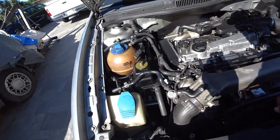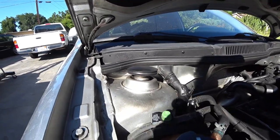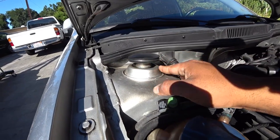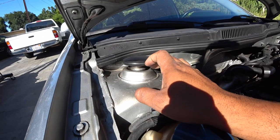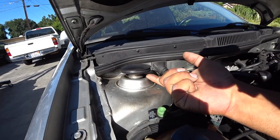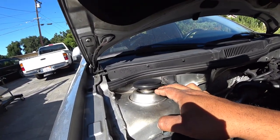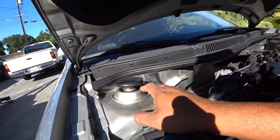Right here, the struts — this is not good. See where my finger is in here? That means the bushings are pretty much shot, way past the good zone. When you buy new strut bushings you shouldn't be able to put your finger underneath there — they sit super, super tight. That's a good sign that it's time to replace these bushings. They're not very expensive.